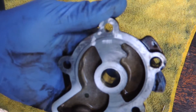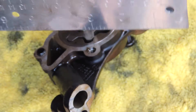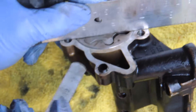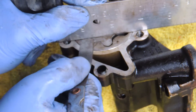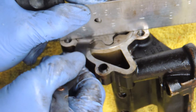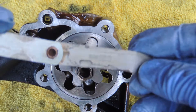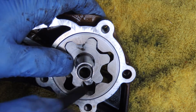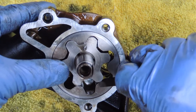Now time to do the inspection. We're using a 0.10 millimeter feeler gauge, sticking it in horizontally — that's the manufacturer specification for this pump. As you can see, the feeler gauge cannot go through the oil pump under that condition, which is a pretty good result. Next test: we check the clearances between the gears using a 0.20 millimeter feeler gauge. We try to fit it in between the gears and we couldn't make it — that's a good sign, meaning the oil pump is not the problem. The problem is the worn-out main crankshaft inserts.